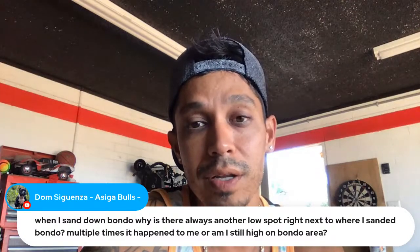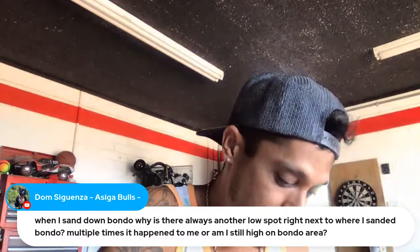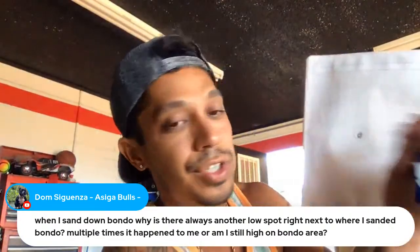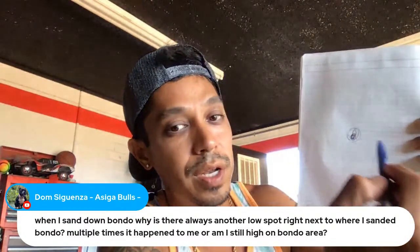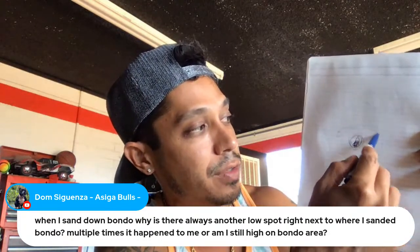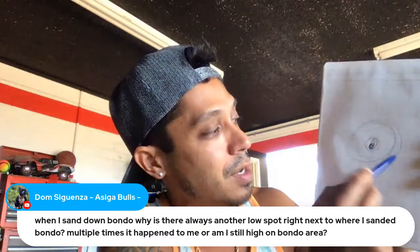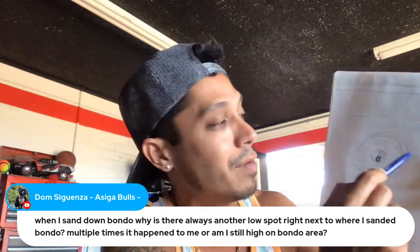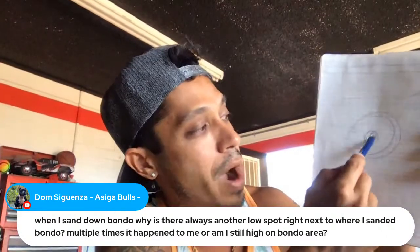And also when repairing a dent, okay, say this dot here is a dent. I know this picture is going to look funny. Say this is an indention on a panel, and it's dented in. So normally when you get a dent or a ding, you're going to get a high spot around it. This area tends to buckle up. So when you're pulling out a dent, could be a square dent or a rectangle or whatever, you want to tap down around here just a little bit while pulling the center out.